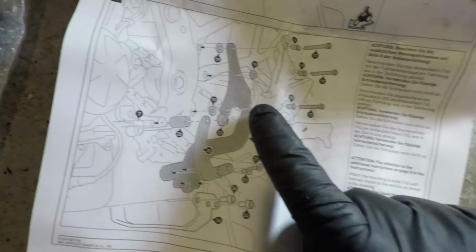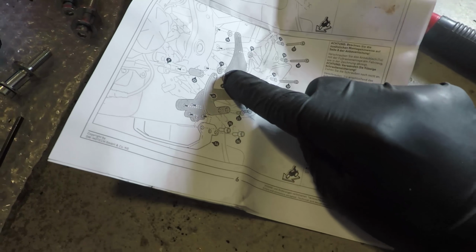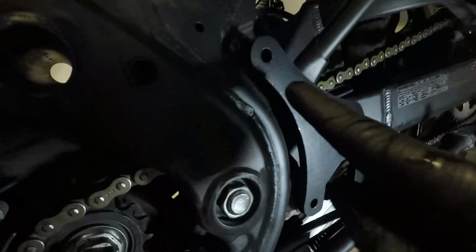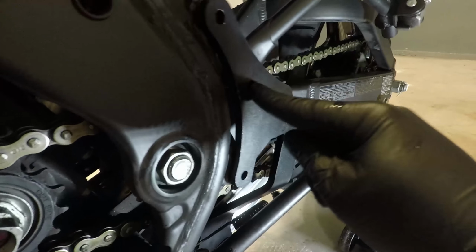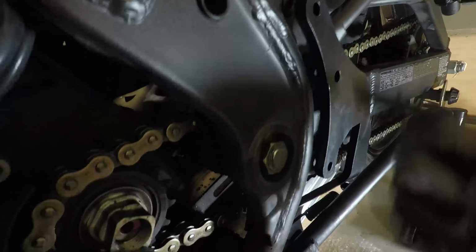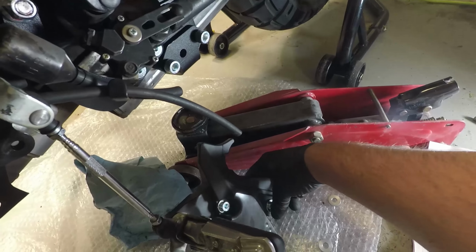But now that's in. Now the only piece is to remount this back onto this new plate, but there's a very specific spacer system. Some of the spacers have to go on the outside of the plate, and then some of the spacers have to go on the inside of the plate, so you have to follow the instructions pretty carefully. So here is another tricky part. The 3 bolts here are going to stick onto these parts here, except the top and the bottom of the 3 have washers that go on the underside of the plate, in between the plate and the mounting system here, whereas this one mounts directly onto here, and the washer actually goes on this side instead of this side. So this one and this one are mounted on this side, the left side. This middle one is mounted on the right side. So we've got the washer set up on here. We're going to put the top and bottom after we slide them in.